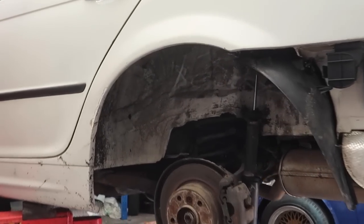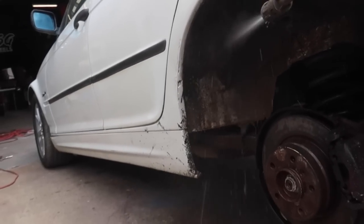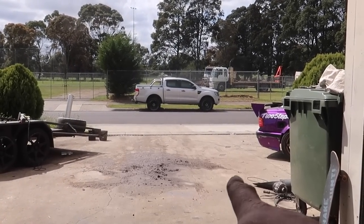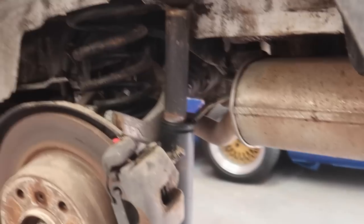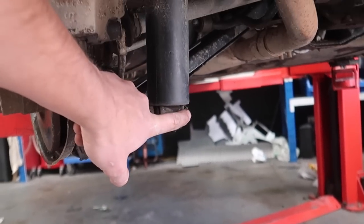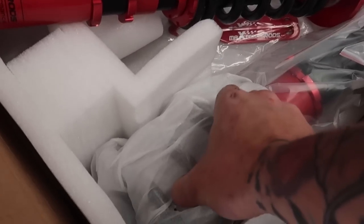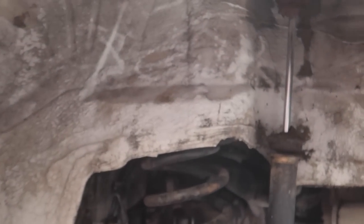Car is in the air, we are good to go. We water blasted the absolute crap out of here before — it was absolutely insanely disgusting. That massive pile of dirt right there is all from underneath this car, which is crazy. So now we've got a clean workspace to work with. First things first, we're doing the rear — undo this bolt down here, two bolts up the top in the boot, and that shock will just come out. Shock and spring separate, take the spring out, then grab the Max Speeding Rods spring and shock and bolt them in. Very simple in-and-out process. Setting the height is another thing altogether.